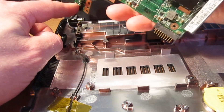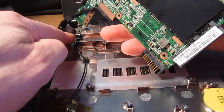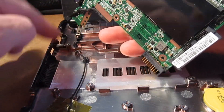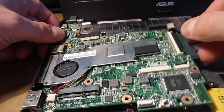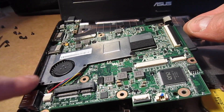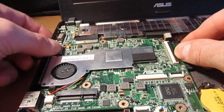This video cable — this monitor cable — you need to be cautious that it doesn't get hung up on the left-hand side, because it'll prevent the board from slipping down into the right spot. What I like to do is just push that down with my finger a little bit. Push this in so that these fit into their appropriate slot, and that's it.